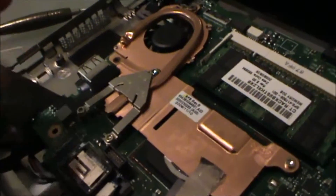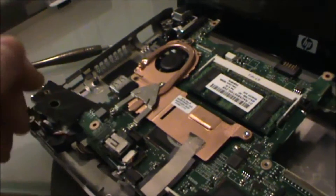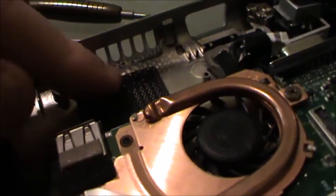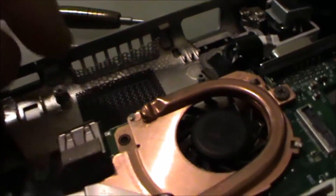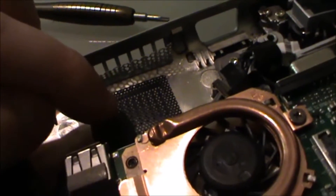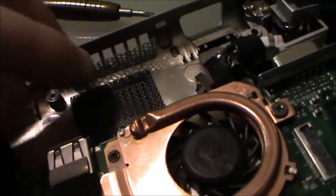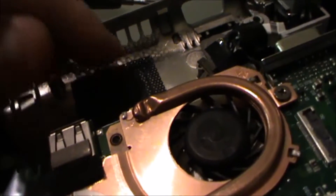For anybody who owns one of these machines, or is thinking of owning one and is concerned about reliability, this piece of plastic mesh is kind of the source of all the problems. The intake mesh is perfectly fine, but as the fan is pulling through, it's got a lot more force pushing the air out, and this restriction is blowing some of the hot air back in. So this needs to be removed.